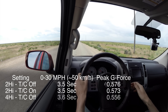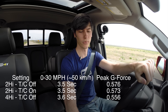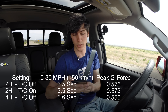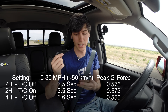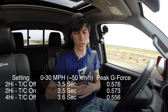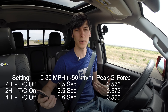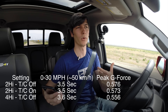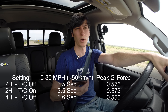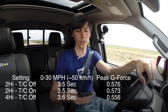The four-wheel drive high run came in at 3.6 seconds. Interestingly, because there are more power losses when driving in four-wheel drive versus two-wheel drive, it was actually slower — 3.55 seconds versus 3.49 seconds with traction control on in rear-wheel drive. You have less power at the wheels in four-wheel drive but more grip, so if this truck had more power you'd see better acceleration. Since it doesn't slip in two-wheel drive, you actually see the opposite — a slower zero-to-thirty time in four-wheel drive.